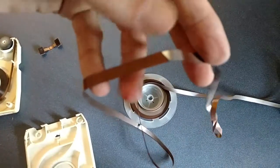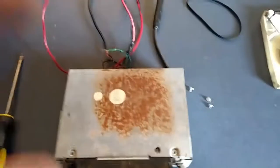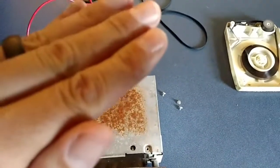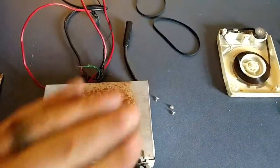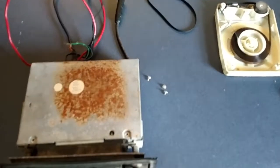The reason the splice is made out of foil is that when I take the 8-track player apart, I'll show you there's a sensor. And when it rolls across that sensor, it causes the head to actually lower down to where it picks up and reads the next track on the magnetic tape. It's a very interesting feature.